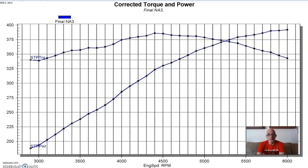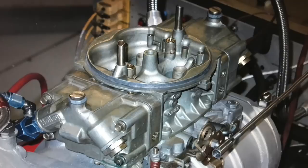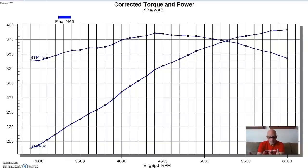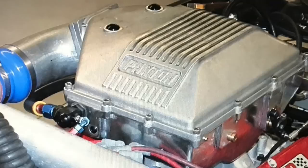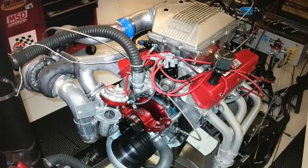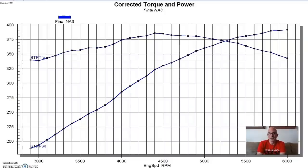This is a really good spot for an intercooler. All of these combinations benefited from charge cooling because we used a carburetor on all of them. The 950 HP carburetor on the 174 blower draws air and fuel through it, which helps charge cooling - same with the blow-through applications on the centrifugal and the turbo. We've seen air temperatures drop as much as 100 degrees going through the carburetor, and even more running E85.